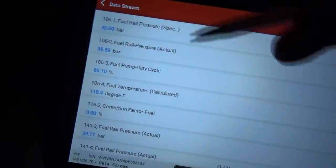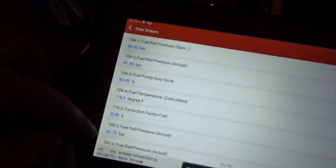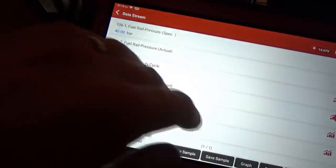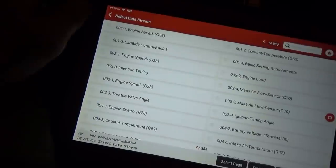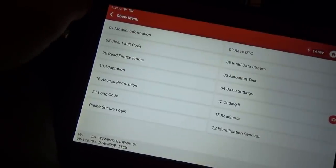Bonus footage: we have our fuel pump duty cycle and desired and actual fuel pressure - everything looks great. 40 bar confirmed, so that's the actual high pressure system working properly. This car is a mystery though - fuses don't jump on their own and things don't get unplugged on their own. I have a feeling the original problem might still be there, or might not. We won't know until we take it for a proper test drive.